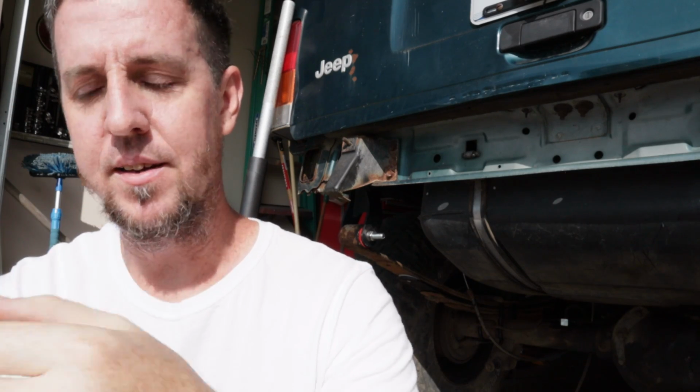But with that heat on there and me tapping, after a minute, maybe 2, I said, all right, it's been long enough, I'm going to try this. It's not very big, so it doesn't take a whole lot of heat to get to it. I put my wrench back on, gave a little bit of a turn, and it turned maybe a quarter turn, and then it broke loose. Started spinning. Came loose from the line. Perfect. I did this again on the other side.